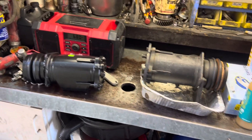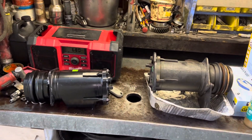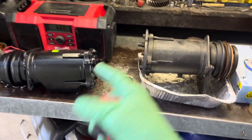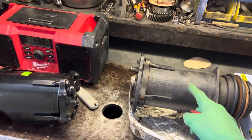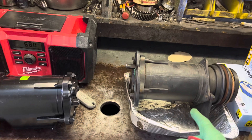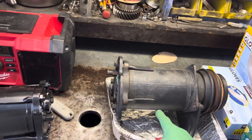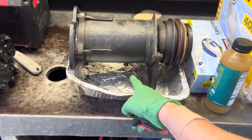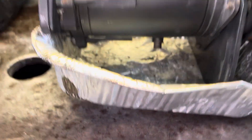I'm here at an old mechanic friend's — I've known him for 30 years, he's a mobile guy. He did not perform an oil balance on his own car when he put in this compressor about three years ago. He forgot to check the oil, and when he had me do the AC, he didn't tell me it came with no oil in it. I took off the oil plug — you can see it right there.